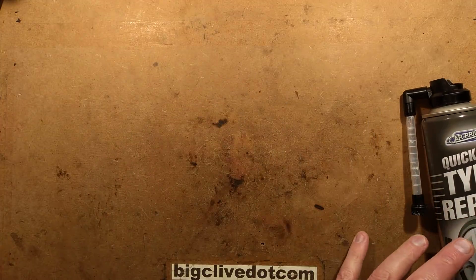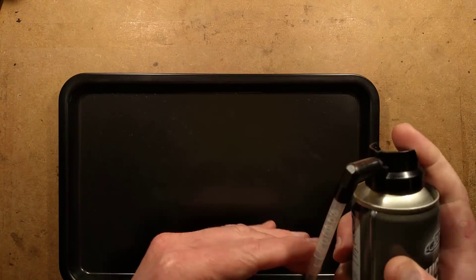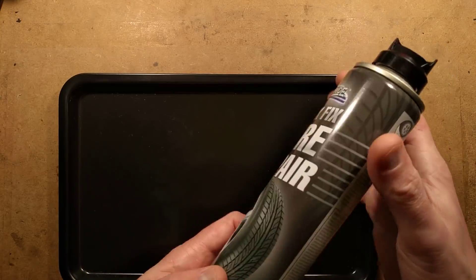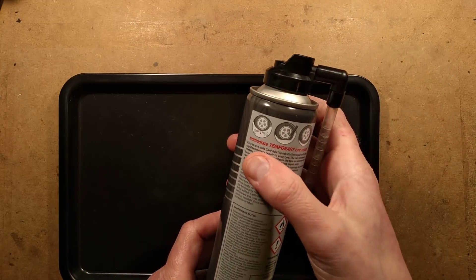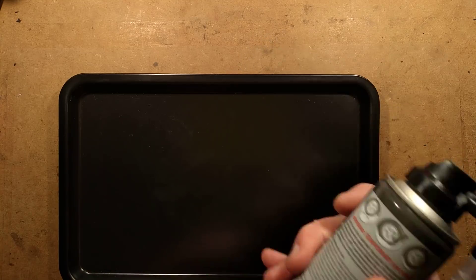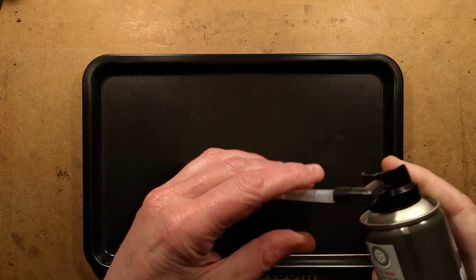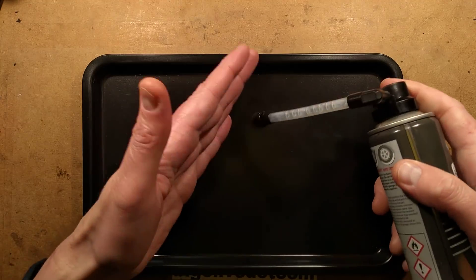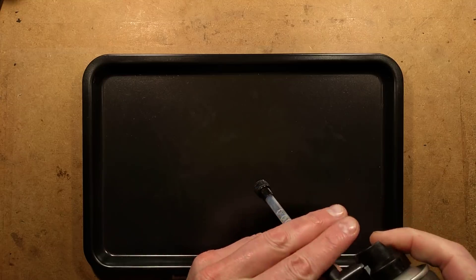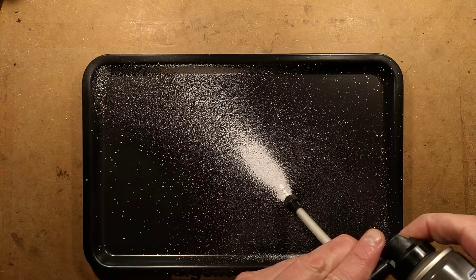I've got a tray here and I'm going to squirt some out. I've already been playing with this — it's quite messy. Things worthy of note: it doesn't seem to matter which way up you hold the can. On the drawing and picture on it, where it makes a special note of being a temporary tyre repair, it kind of shows it with the base pointing up. But I think it operates in all directions. It can be used regardless of where the fill valve is — top or bottom. If I press the button, initially it just blows out gas and splooge, but after a while it starts squirting out the foam.